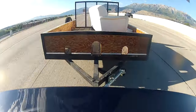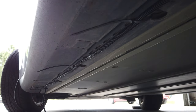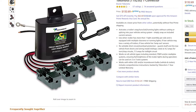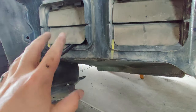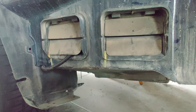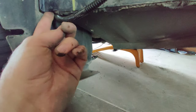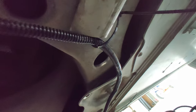This was all one big combined project because to do the trailer wiring, I needed to have the bumper off anyway to route the cables out of the car and across the bottom. The trailer light wiring module I chose requires its own 12-volt power supply because it does not tap directly into the power in the back of the Tesla. I ran that wire out through the vent on the driver's side and up to the front of the car. If I were to do this again, I would recommend taking it out of the passenger side vents instead.